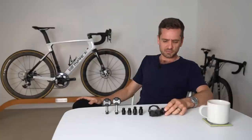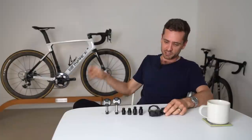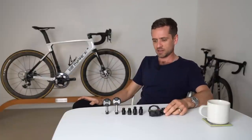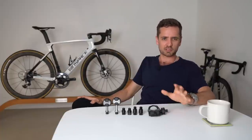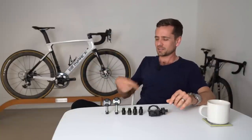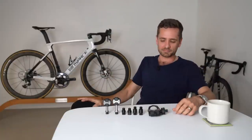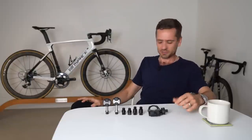It's around 150mm for road bikes and about 170mm for mountain bikes. There's some variation in bottom bracket standards and crank arm shapes and all that kind of stuff, but it's a pretty narrow band. We're talking fairly specifically about road bikes, so we'll stick with that 150mm between the two crank faces. It goes up and down a bit depending on how far you thread the bearing shells into the frame, what curvature and shape the crank faces have, and how many washers you use under the pedal.